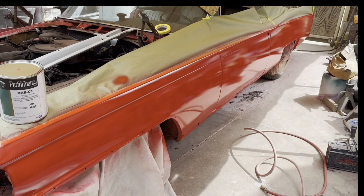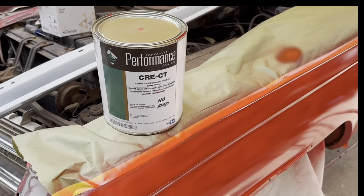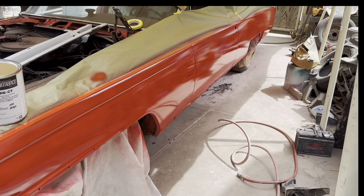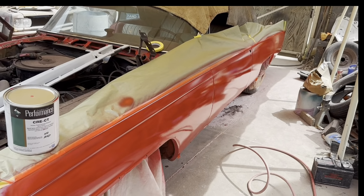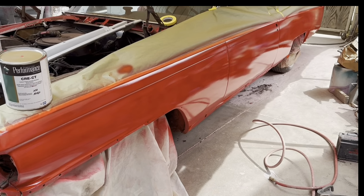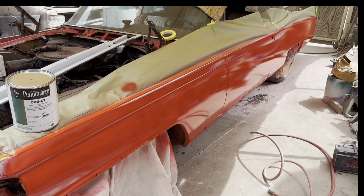Epoxy primer, by the way, I got from the store. My first time using it. There it is, right there. Sprays like clop. You can see how straight the car's coming out, however. Looks pretty decent. It's pretty see-through. You can still see some blotchy areas. And I got 3 heavy coats on it. So, I don't know. I'm not real happy.